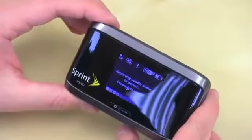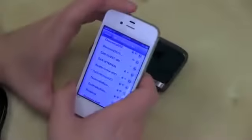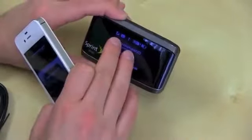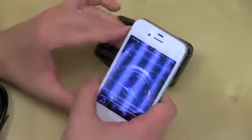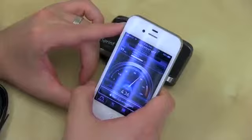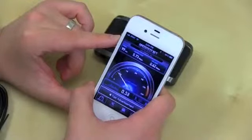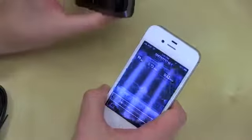We are connected to the Sprint hotspot. I'm using an iPhone for testing. Going to Speedtest — it shows we are connected over 4G, which is WiMAX. You can configure the network name and password through Sprint hotspot settings. We're getting pretty decent WiMAX speeds — five megabits down and looks like about one megabit up. The five down is comparable with LTE speeds around here in Southern California. The upload is a little slower — usually one to two up — but certainly serviceable. This is a surprisingly useful device with WiMAX.